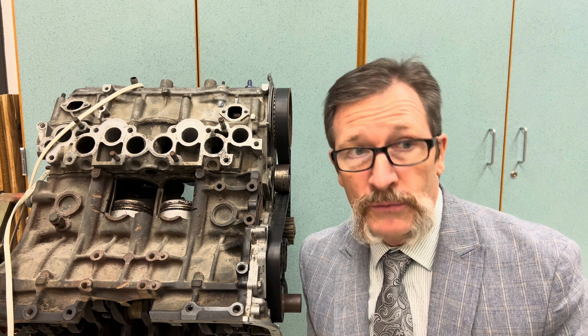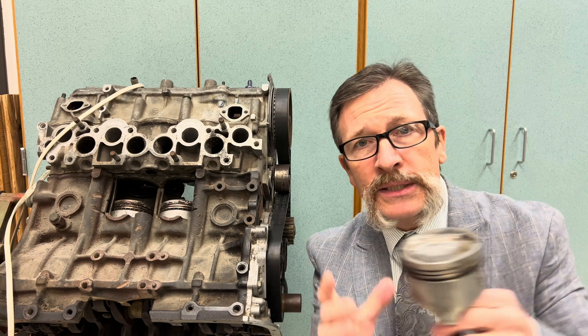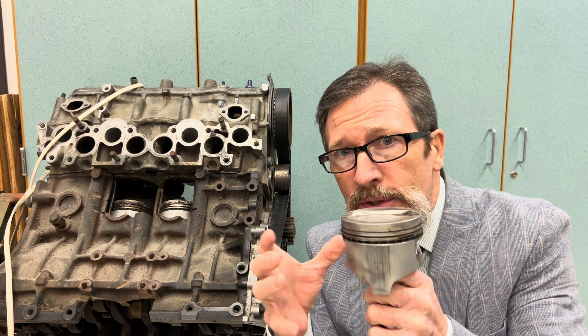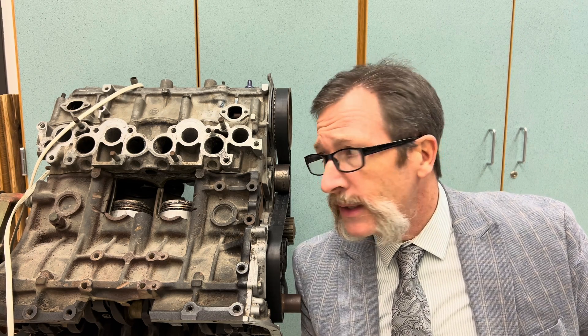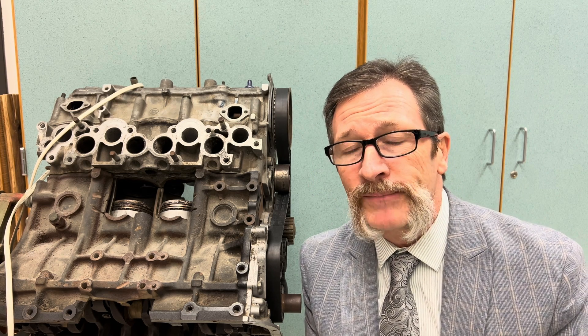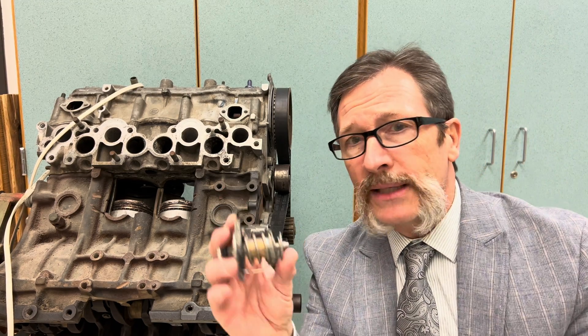In the north, where I live, it gets very cold. If our pistons are made of aluminum and those molecules are barely vibrating — as small as they're ever going to be — as you start an engine it's going to warm up and all of these components will expand at different rates. That's what engineers have to contend with. We know that really bad things can happen with dissimilar thermal expansion rates, and engineers have to take this into account. None of this would be possible without the thermostat.